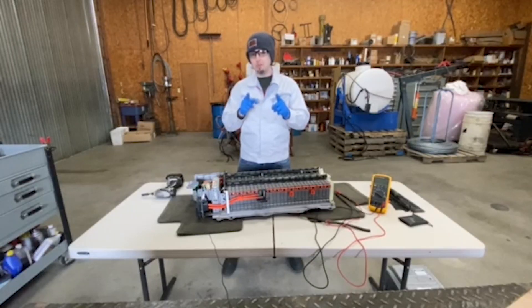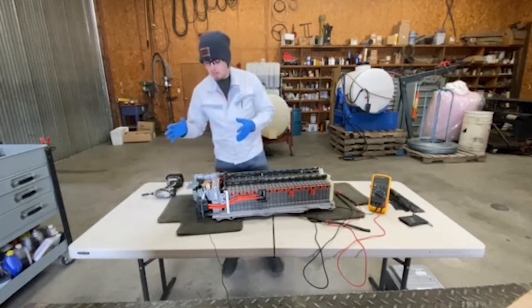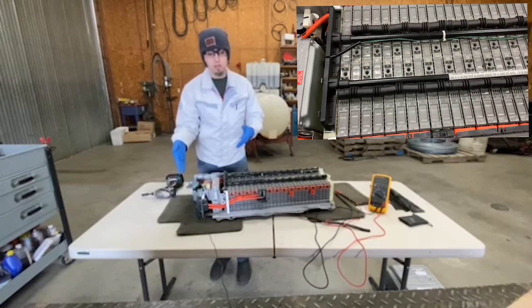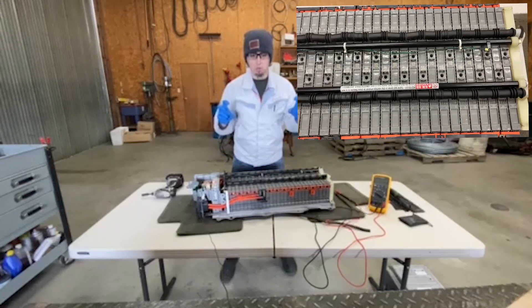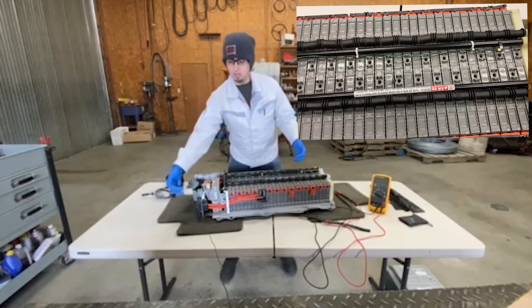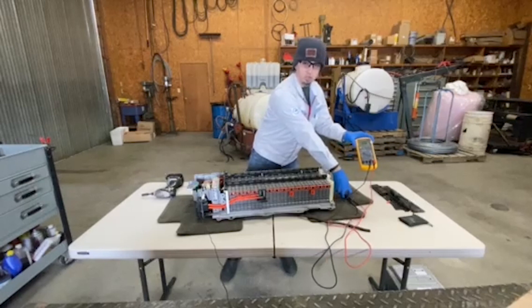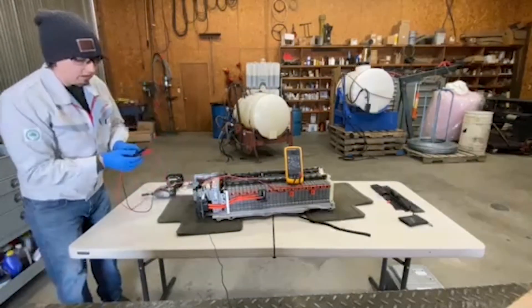How safe are hybrid batteries? Are they dangerous to work with or touch? Are hybrid batteries dangerous? The short answer is yes, but you don't need to be scared about it if you know what you're looking for. I have this particular hybrid battery depowered — I have the service plug grip, or the main battery connector, removed from the battery. What this does is it essentially splits the battery in half and drops all of the high voltage out of the battery at the terminal. I've got my trusty Fluke meter here and I can show you safety in testing this battery.